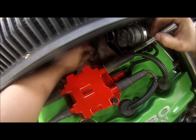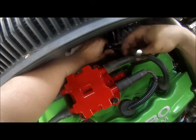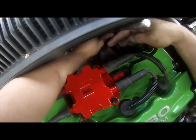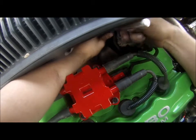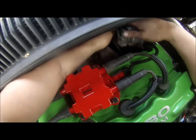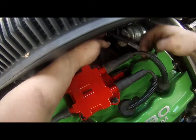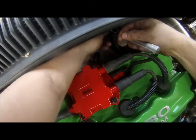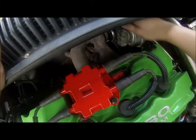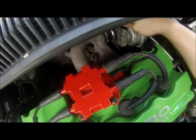I'll turn this up so I can get the wrench and ratchet in here a little bit better. This flapper here is the wastegate valve — the little flapper inside. Go ahead and loosen these bolts — they're put in pretty good so I want nothing going nowhere. Once you get them loose enough, just get them out.